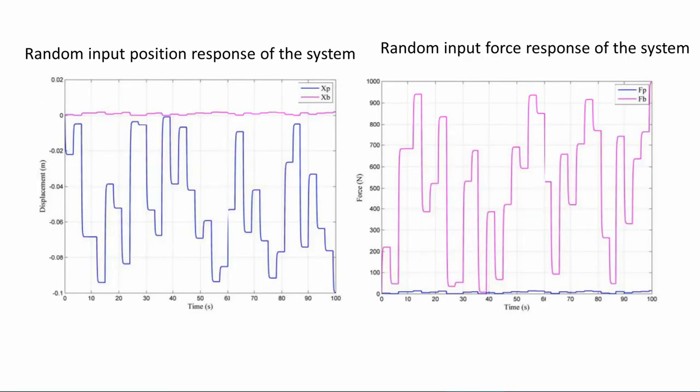The last test is the system response for a random brake application. The system amplified the brake force as shown in the right picture, and the brake pedal and brake motor displacement for random force application is shown on the left. The proposed system correctly amplified and followed the driver pedal, providing brake boost with smooth transition. The system shows good force amplification and pedal spring effect for dynamic force changes.